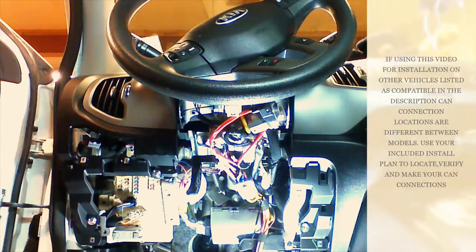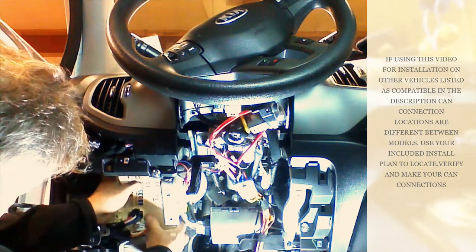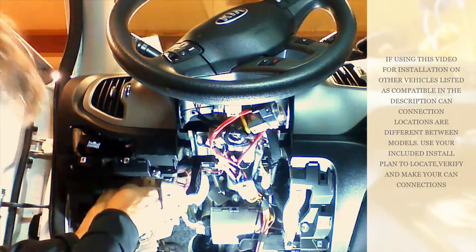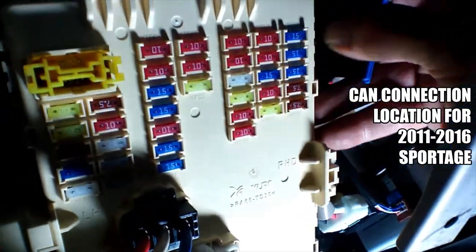We need to get to a plug on the back of the fuse box BCM assembly, so we've taken the nuts off to get a little room and pull it back so we can get behind there to unplug the plug. We're just going to pull it down a little bit. We're going to release this blue harness by pulling forward and removing it. We slid the blue plug off the side of the BCM fuse box assembly and need to make two connections behind here.